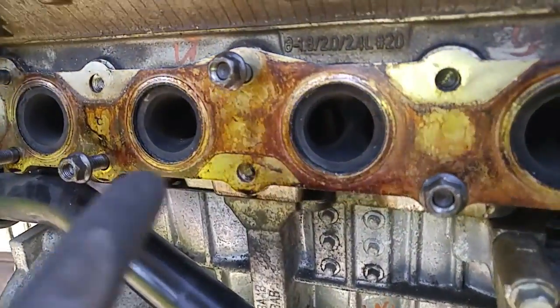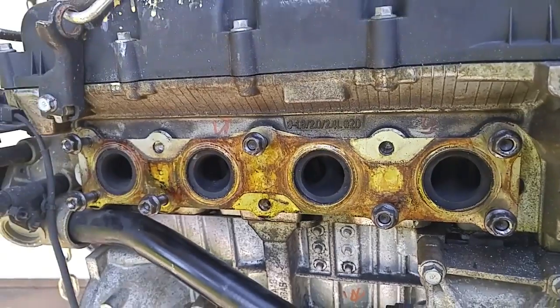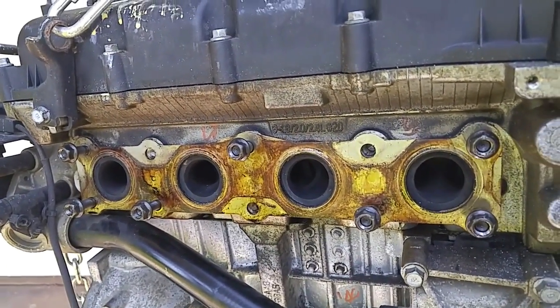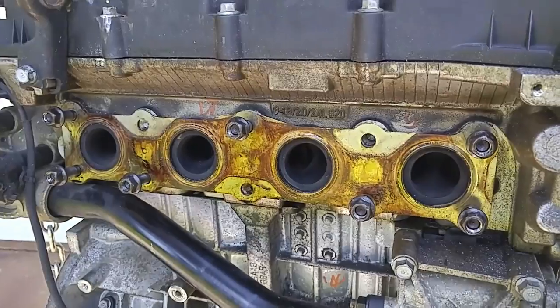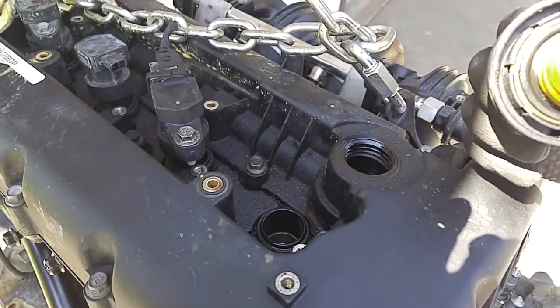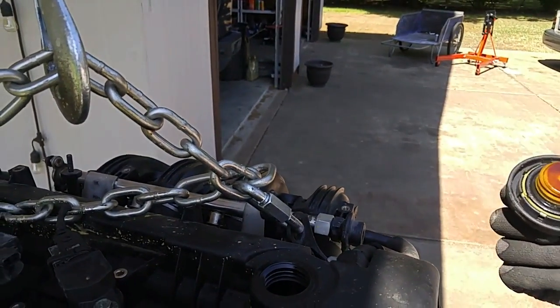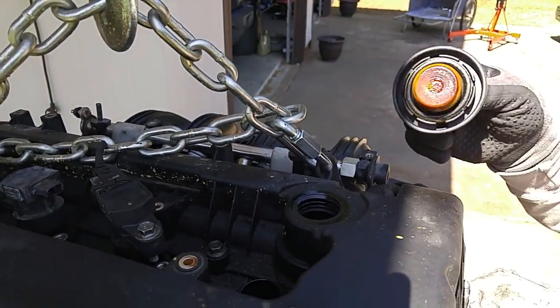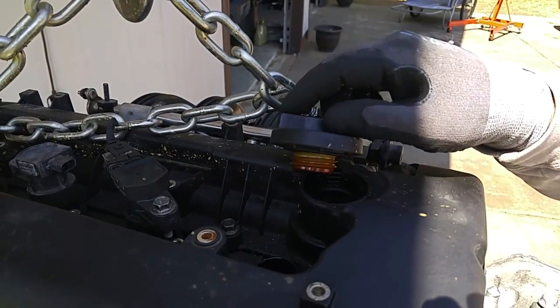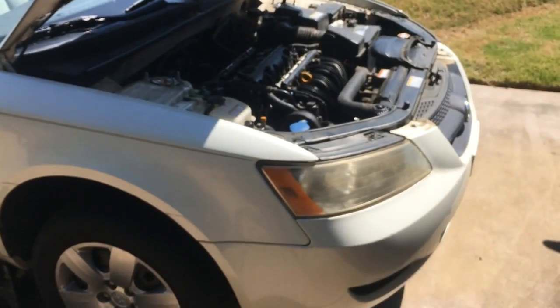I also go to the exhaust ports on this side and look for any strange discoloration. The color on the exhaust ports should be consistent. Remove the valve cover cap and look for any milkshake-color oil sludge in the cap and valve train — this would indicate the engine had overheated and blown a head gasket, allowing coolant to mix in with the engine oil. Rotate the engine with a ratchet wrench to check for any resistance points.